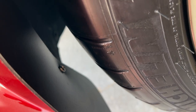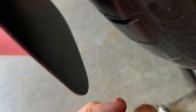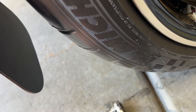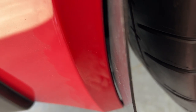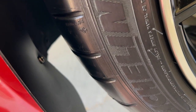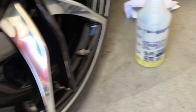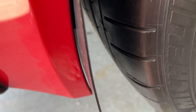I had to pull it over hard with my right hand while lying on the ground and try to screw it in with my left hand — not ideal. It is doable with the tire on, but it's probably best to just remove the wheel. The front and the top two rear bolts are a piece of cake. The bottom one is tough because the spacers are longer. On my Camaro I had a shorter and longer spacer which made it easier.